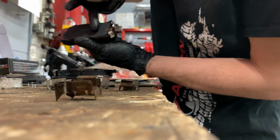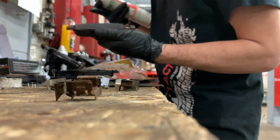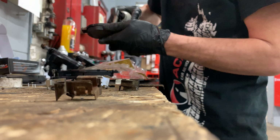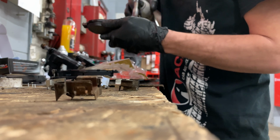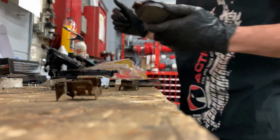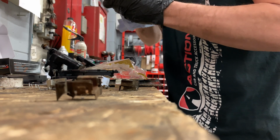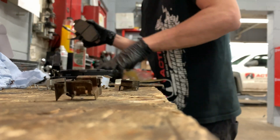And then on this pad section right here, the piston from the actual caliper itself sits here. For instance, my fronts are two pistons, so there's a piston that sits here and a piston that sits here. I usually put a nice little layer where they touch, and that way I don't have any noises. Alright, now just go ahead, pop this bad boy in here.